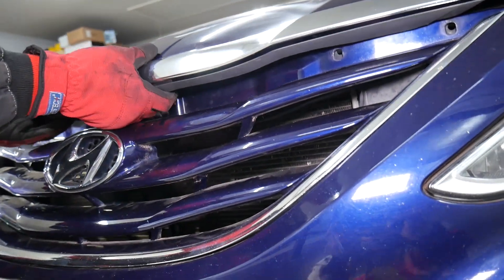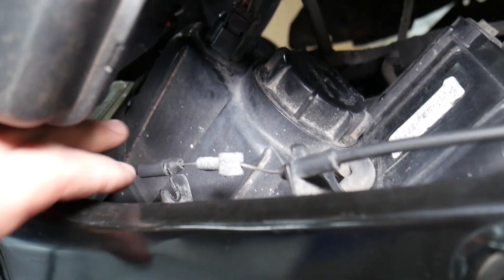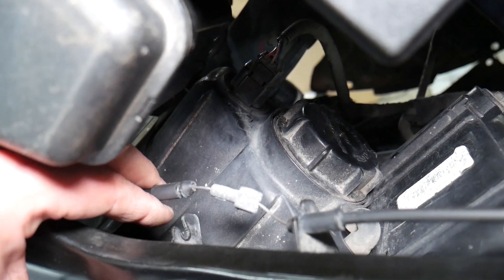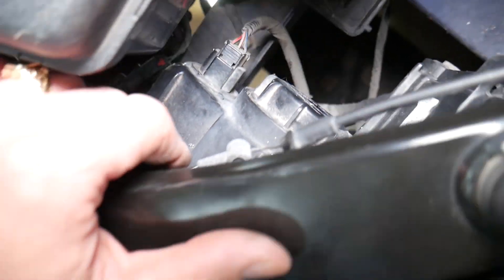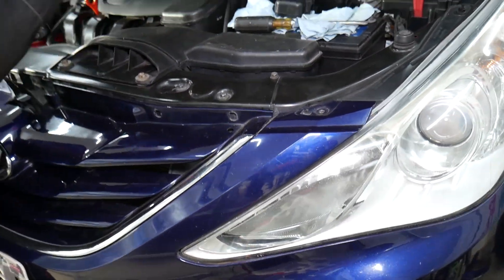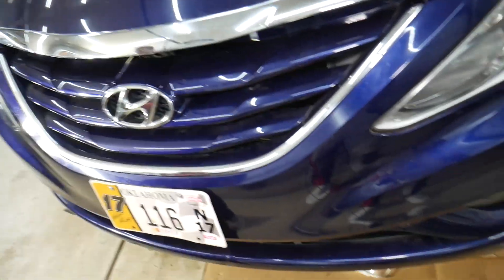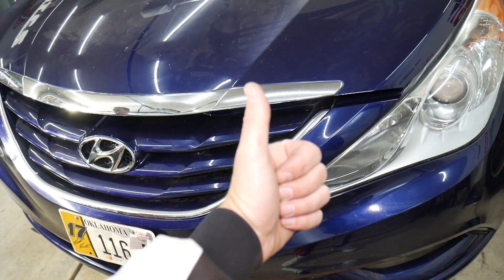The hood just came loose and we can open it. The problem with ours is that mechanism right here broke — you can see — and it comes off. As a result, when it's off like that, we cannot open the hood. Unfortunately, we'll have to replace the cable. You may break something doing this, but at least you will be able to open your hood and fix the problem. Once you open the hood, you can remove the grille and replace the hood latch as well — we have a special video that explains how to do that. Hopefully the video was helpful. Thank you for watching and see you next time.